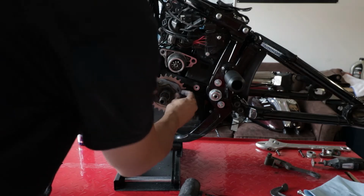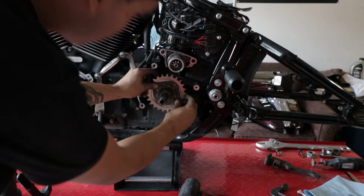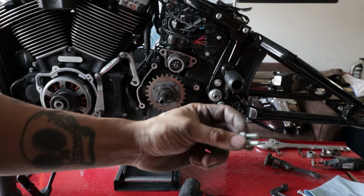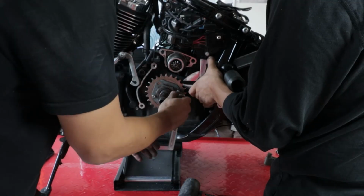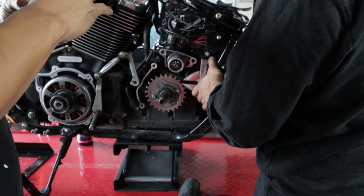And then you would install this. Oh, dog, look at that. No shaving necessary. That's as good as it's gonna get. And then just apply a blue Loctite to these bad boys. Lock plate screws is 90 to 120 inch-pounds, yes.